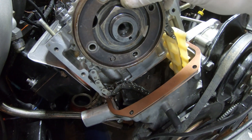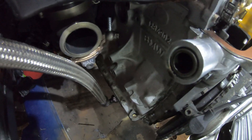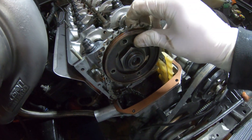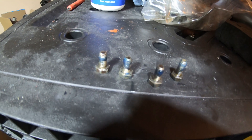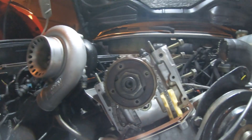If you're coming off, you'd want to get that lined up, make sure this matches up, and then just start taking the cam gear bolts out, loosen them up a bit, then take the tensioner out around the side here — I believe it's a 19 millimeter. I also do a little bit of blue Loctite on the cam gear bolts. Probably not necessary, but better safe than sorry — I'm from New York so we trust nobody.